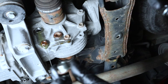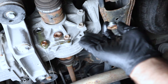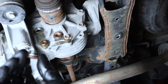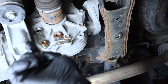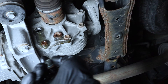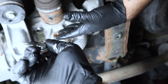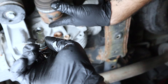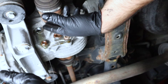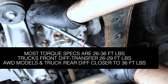We have a steady drip — that is the correct level, not the false overflow we saw earlier. Now we wait for it to finish and slow to a drip, then install the fill plug with a new gasket. Notice how the fill plug is almost at the same level as or just below the axle — this is always the case. If you put it over the axle, the seal will be submerged in fluid and it will leak. This is what happens when you overfill: they will leak.